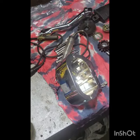So this is what she looks like when it's all done. You're gonna wanna put some oil back into there. You have an oil fill plug here, so you just take that out, fill your oil up until it pours out of there, and then you know you're at the right level. But then the next step is to start her up, get her going. Well, look, and Donny got some new pipes, so we're gonna put those on too. Then we'll get this bad boy all started up.